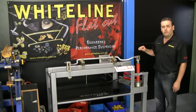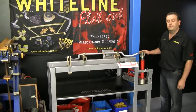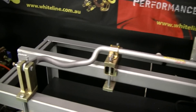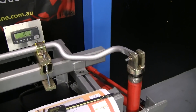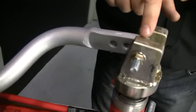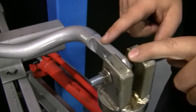We will use and test our OE sway bar samples as well as our manufactured samples to see what the rate changes are overall. On our OE sway bar sample on this particular vehicle, it was a 24mm sway bar. We've only increased the sway bar rate on the softer setting — you can see here in the three adjustable holes. We've got about a 15% increase on this sway bar, but we could go up to 80% increase on this one as well.